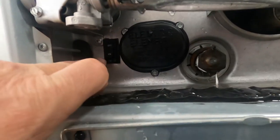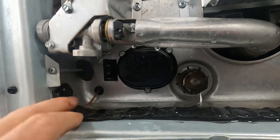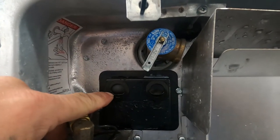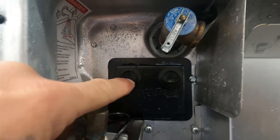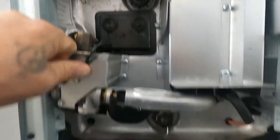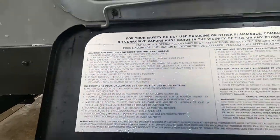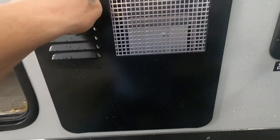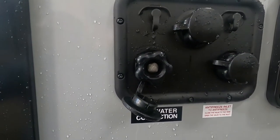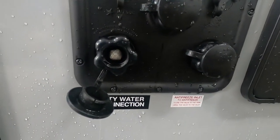You can turn your hot water heater on from indoors. There is an on/off element down here — only turn this on down here if you're plugged into 110 — turn it on here as well as indoors. If your hot water heater is not working, come out here and look — it may just have tripped; press down on it, it's a reset button. There's lots of information right here that I've covered.